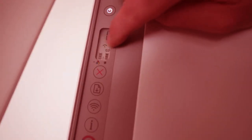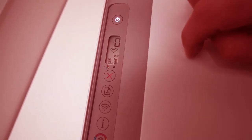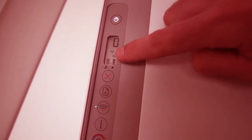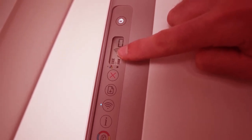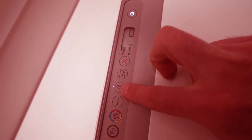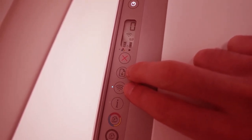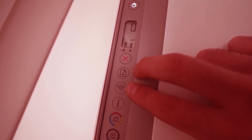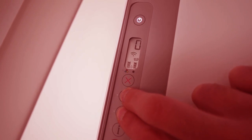You need to make sure you have a small icon showing a phone with a printer. If it's not there — like in mine — all you have to do is take two fingers, press the Wi-Fi button and the button right above it — there's an arrow on a page — press them both at the same time and the icon will appear.